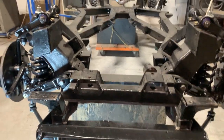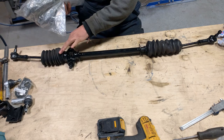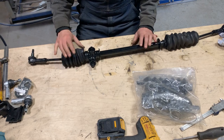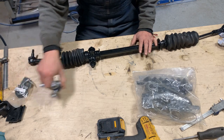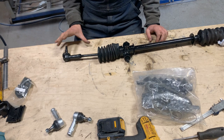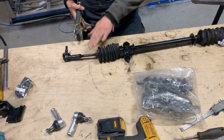Let's take care of the steering rack now. Here is our steering rack and we have new boots from Shadetree — they come with proper clamps for the gaiters, not just zip ties. As we're changing the gaiters we should also inspect the balls, the pinion, and everything inside. We're also changing the tie rod ends — we have new ones. KJ painted them. I'm going to count the number of threads I'm removing so I can put the new ones in the exact same position and see if alignment adjustment is needed later.